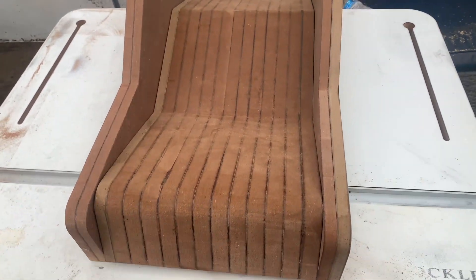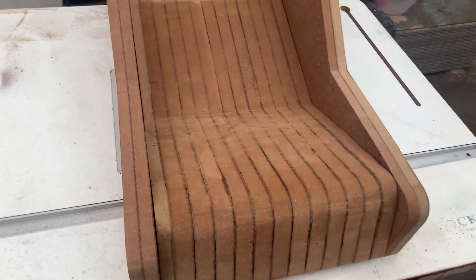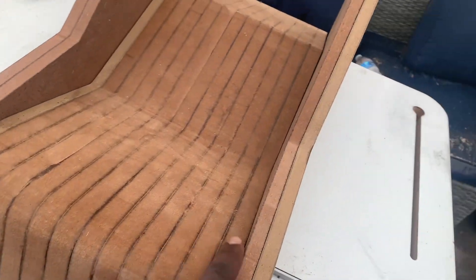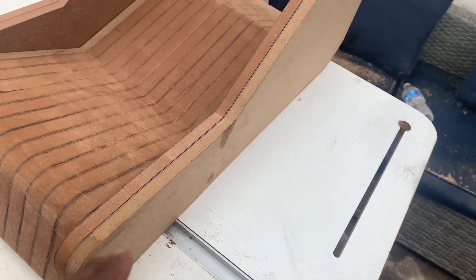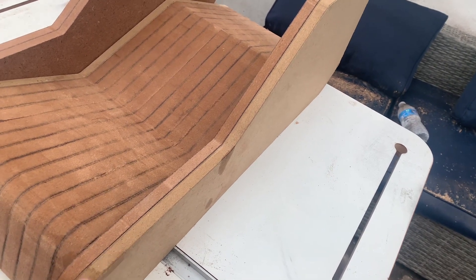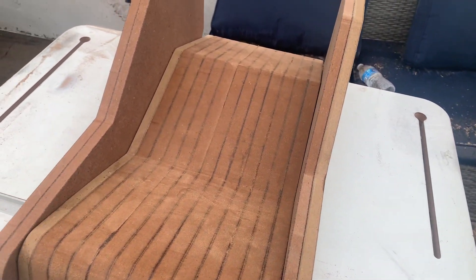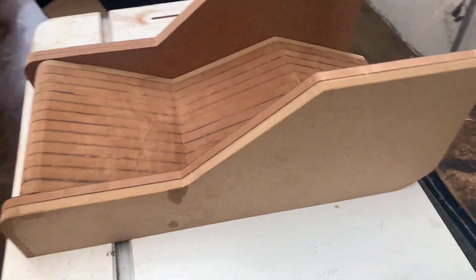What's good YouTube, Anthony Lyons, AL Designs, back with another video. As you can see, working on that center console for Phil going to Arizona — coming along stack fab. As you can see, got all the layers stacked so I can get my width side pieces. We're about to start doing the profile edges, so this edge here will be a chamfer edge, and then get it ready for some body filler so we can get this bad boy wrapped up.